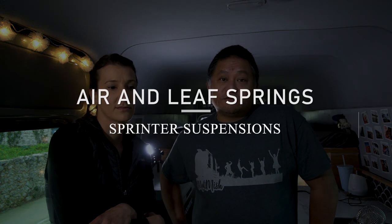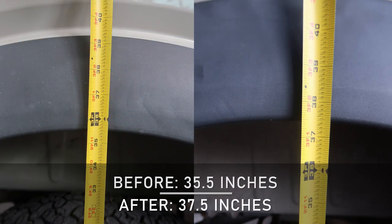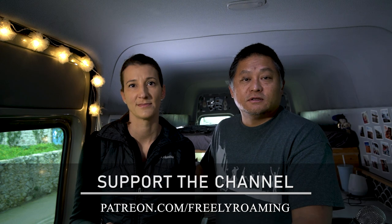The van is originally rated for three and a half tons, and now with the additional leaf spring it's technically able to handle five tons — though we didn't get it re-rated. For those considering suspension upgrades for a Sprinter or any unibody van: look into this carefully. You probably want actual leaf springs added to your rear suspension rather than relying solely on airbags. We put the airbags back in but without the spacer — since they're no longer supporting as much weight, they're now just acting as heavy-duty bump stops, which is what they're designed to do.